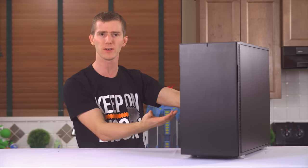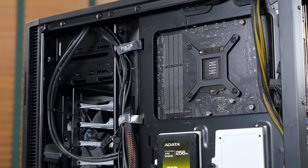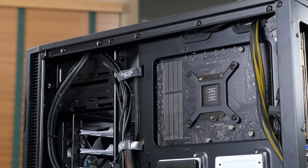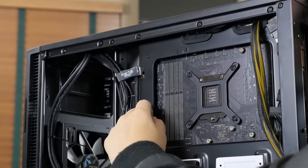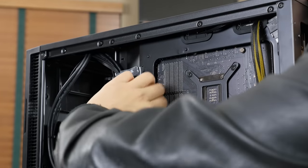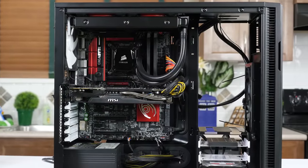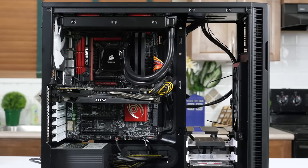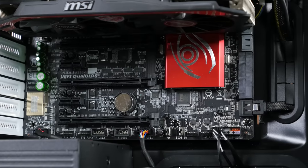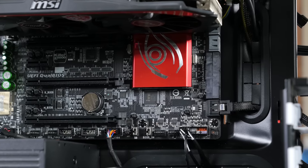The rest of the insides from this side are pretty standard fare. The motherboard tray's only remarkable characteristics, other than the usual big CPU cutout and well-positioned cable management holes, were how surprisingly solid it is, even with all the front bays that it anchors to removed. And the way that the motherboard area sits slightly recessed — something that may cause clearance issues with those slightly wider than ATX enthusiast boards, if their right-angle connectors on that edge are in awkward locations.